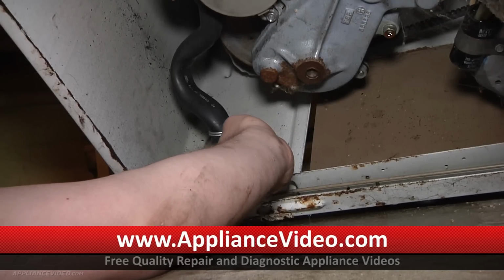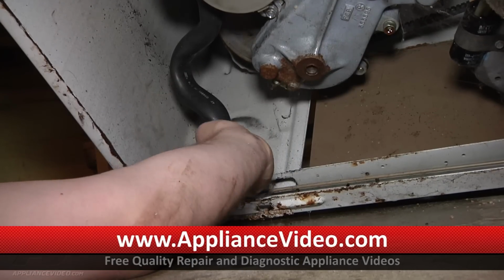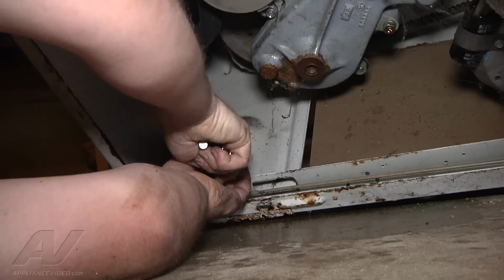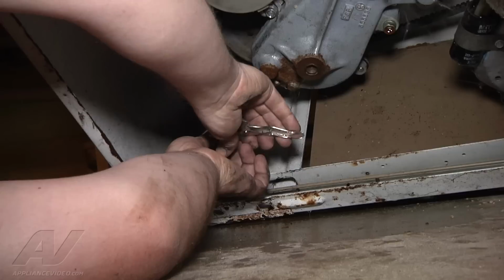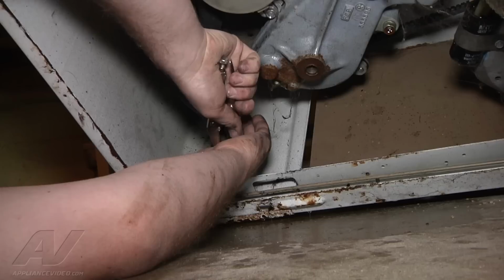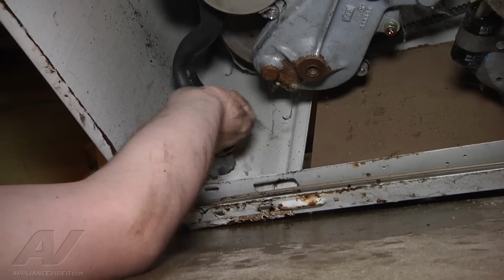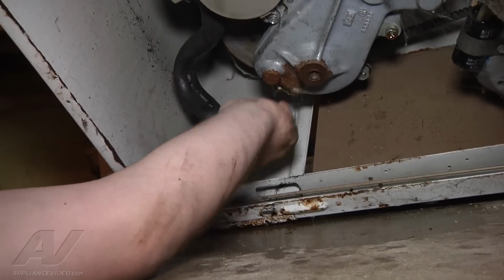There's a screw here, and these two tabs go into these two holes above it, and the screw goes through the back there. It looks like somebody might have done that to originally fix the kink in the hose, because originally this 90 would have come through this upper hole, which would have pushed the hose up and kinked it more. So we're going to leave it the way it is so that we can eliminate the kink. But that actually should be mounted, so I'm just showing you where that originally would be. And our spring clamps are back on.